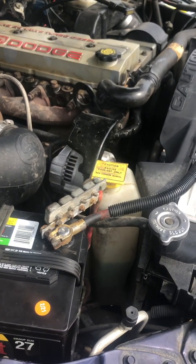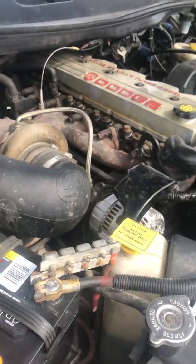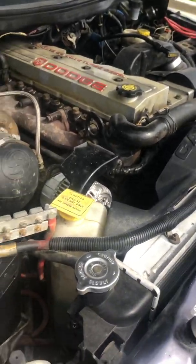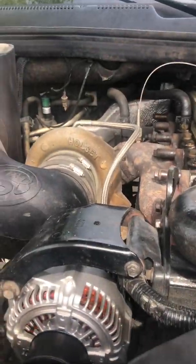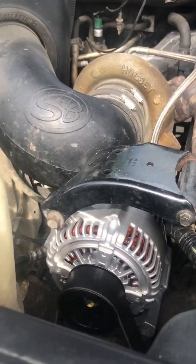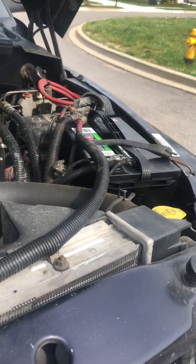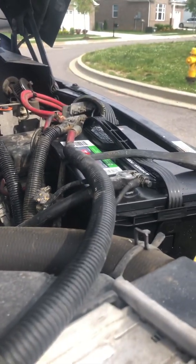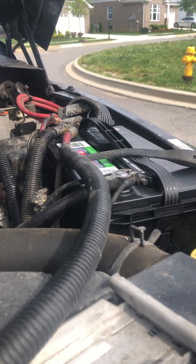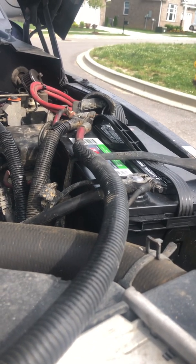I also want to talk about something people don't discuss. I could have replaced the alternator, put it back together, and it would still be overcharging — even with a brand new battery. These trucks are highly sensitive to battery connections because of how the system works. The PCM drives the alternator; the alternator charges the passenger-side battery first, and then through a cable it goes to the driver's-side battery. The PCM is reading that passenger-side battery, which has a battery temperature sensor underneath it. If the battery gets too hot, the PCM reads that and shuts the system down.